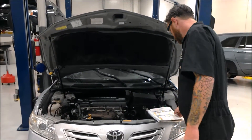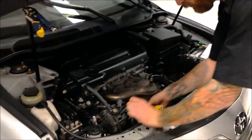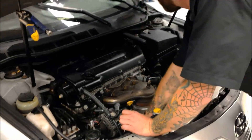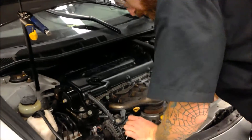I'm looking for corrosion as well as checking for leaks on any hoses. I'll feel around — if I feel any moistness with my fingers, I'll check the hose further to make sure it's cracked and not just a loose fitting. On this vehicle I actually didn't find anything wrong with any of the hoses.